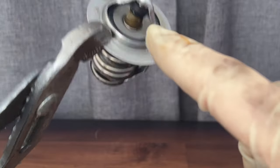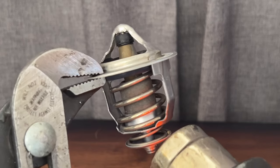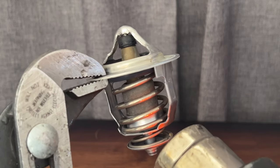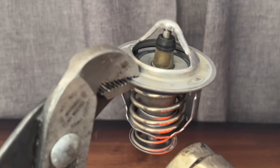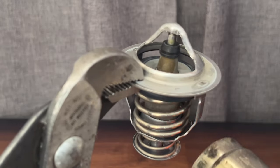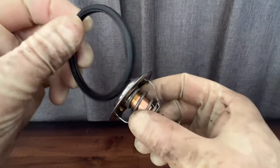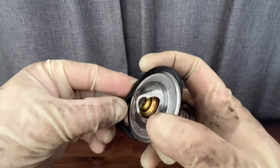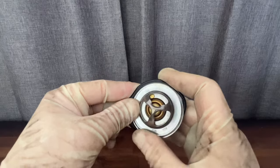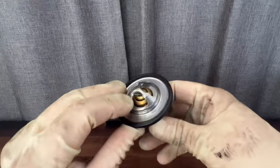If you don't know how these work, they're actually really simple — that little plunger basically goes down, and as the spring gets hotter it opens up the little valve. I'll show you with a heat gun: at the top where I'm holding the pliers, you'll see the black plunger coming down as the valve opens with heat applied. This is what lets the fluid flow through the engine block to keep it cool and back up to the radiator. Now install the o-ring onto the new thermostat, looking for the little slit in the middle of the o-ring, and work your way around to seat it fully.